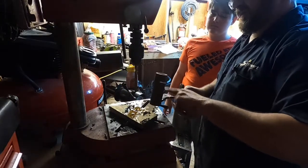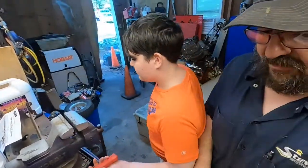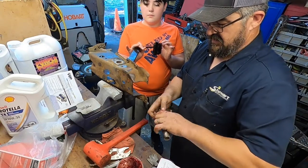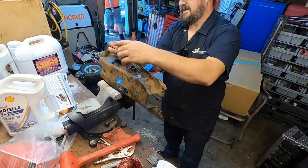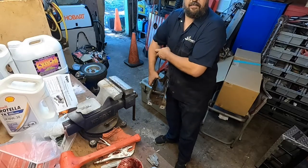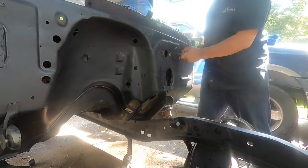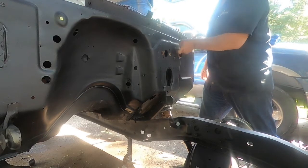We got ourselves a hole — and that was the easiest hole I ever drilled. I'm gonna grease this up and put it back together. Take some grease, coat the inside, slide that bushing in, the other bushing in right here. Spring — there it is — beautiful. Now we can go put it back in the truck and mount the brake booster. There goes my firewall paint job. I'll go back in the cab and snug those up, and then we're going to bolt on the master cylinder.